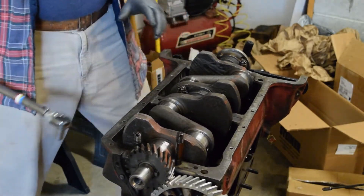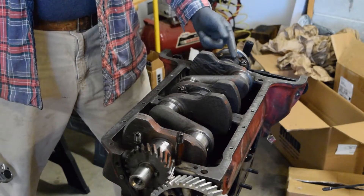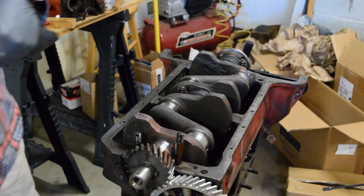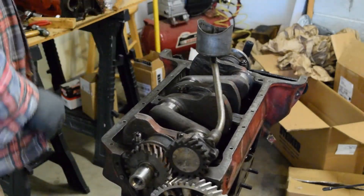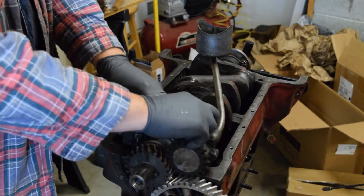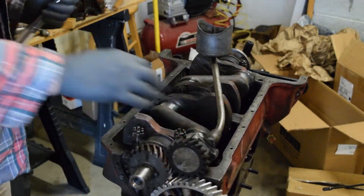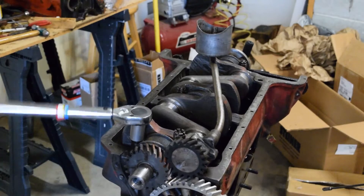We're going to get some wire — we put wire through the bolts and the nuts and then criss-cross it and wire it up. If the notch in the nut doesn't line up with the hole in the bolt, tighten it a little more — it's not going to hurt anything. The spec is 75 to 85 foot-pounds so it'll be okay. I'm not going to reset my torque wrench back to 45. Feels like it's cross-threading a little bit, but it's going on like butter — no problem.